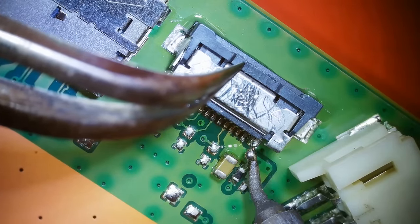We're clearly going to need a new heat sink — there's nothing we can do to really fix this. We could try and bend the fins back but it's just not going to go well. I do have another one of these already, so I'm going to get that and install the board onto that heat sink. This heat sink was from a video I did a long time ago where one of these chips overheated and blew out. So what we need to do first is apply the perfect amount of thermal paste. Now we can get this thing reassembled enough to test and see if it'll turn on, along with a known working power supply.